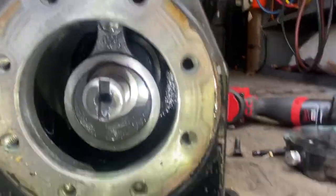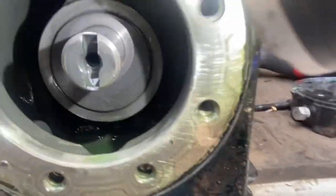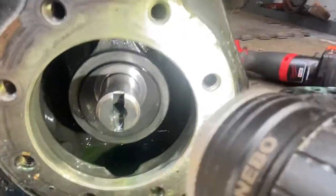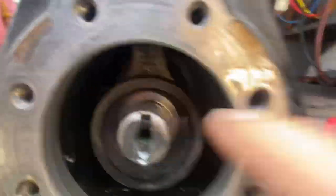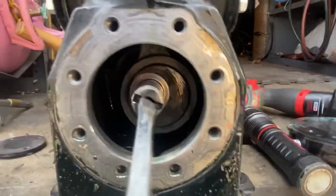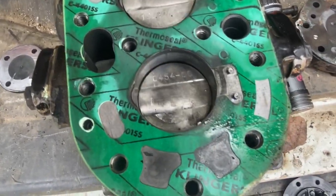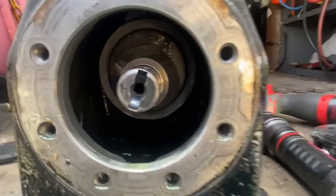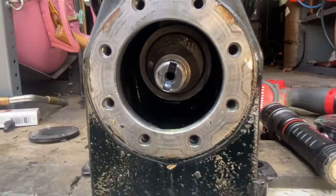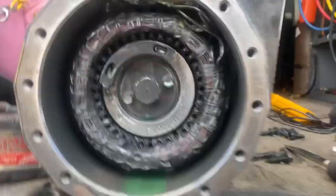I drained out some of the oil. If you've never seen it, this is what the inside of a crankcase looks like on some of these — obviously the bigger ones may have more. There's the bottom of our pan, crankcase, everything looks decent in there. There are our pistons and piston rods. This was stuck, but now I can turn it — the crankshaft is turning and you can see how it's pumping the pistons up and down, just like a car engine. But this was stuck, and also in here there is some black — you can see that in the oil — and it smells like a burnout, but not a full burnout. I know this was seized and drawing high amps, so I want to pull open the front because I believe it's the electric motor that was seized up.